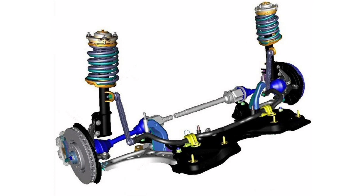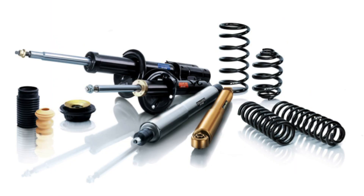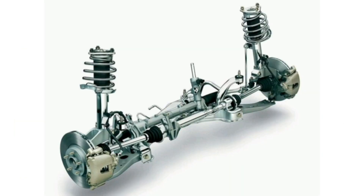In short, McPherson suspension is a suspension system used in automobiles, characterized by its simple design, efficiency, low cost, and efficient use of space. It is made up of a swinging arm, shock absorbers, a suspension spring, upper bearing, and in some cases a stabilizer bar. Its main function is to absorb road irregularities and provide a smooth, comfortable, and safe ride.